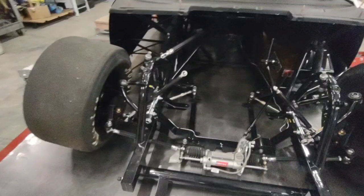The one place where I am close is on my tie rod. I did notch out the frame there for the tie rod. You see that a lot on the new cars. There are a couple of companies, like Wares Machine, that build a kickdown lower tie rod to keep this from happening. But again, I don't have my bump set. I think I'm a bit high on that. So by the time I'm all finished, I'm not going to have any issues with bind. I've got free travel everywhere. And ultimately, it's going to work out really well.